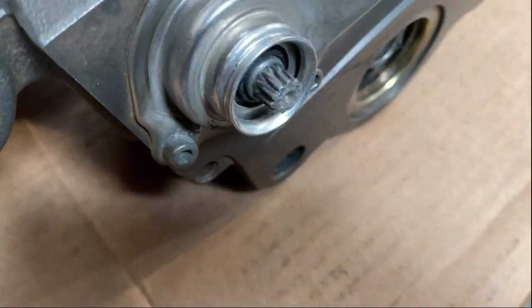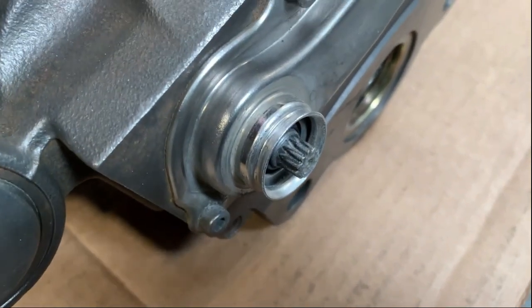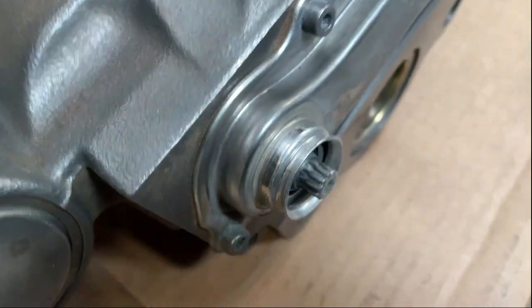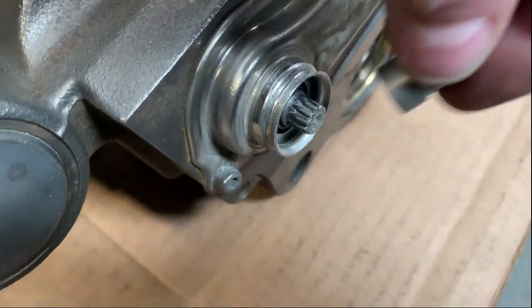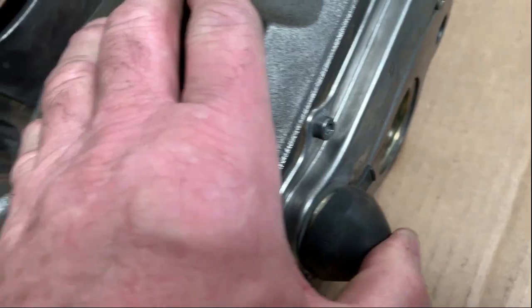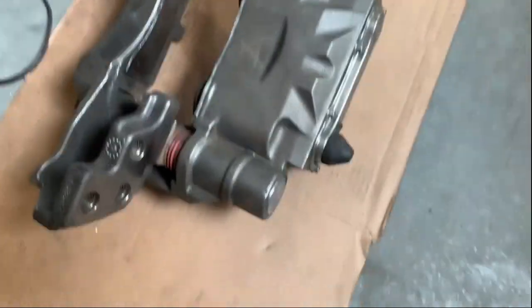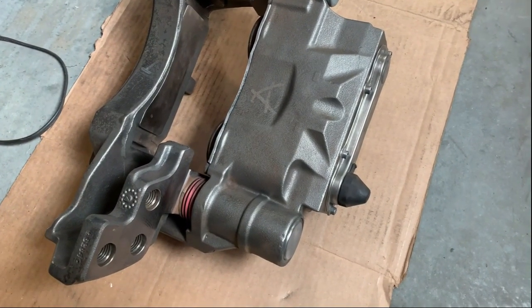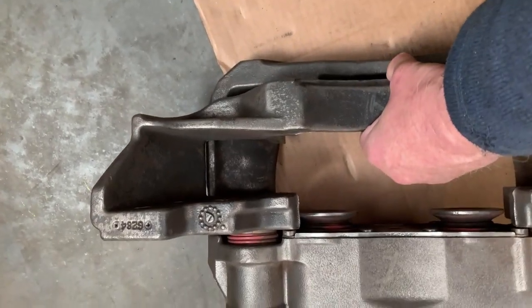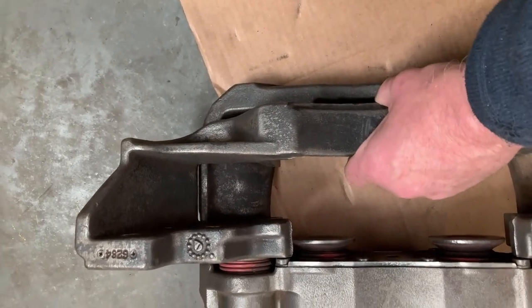The whole purpose of this cap is to ensure you do not put too much pressure and torque on this mechanism, which inside could damage it. From all the literature I've been reading, you can't buy kits to repair this - it's a new caliper and they're expensive. Here's the dust cap that goes on. Now I'll install this back onto the coach and show you the clearances I've got, just to show the movement you should have on these calipers when it's fully depressed and pulled in.